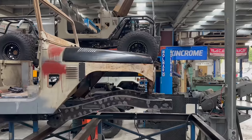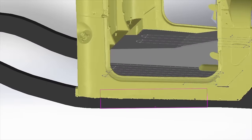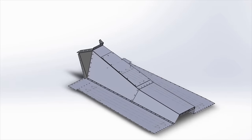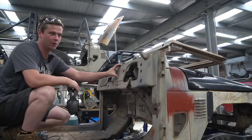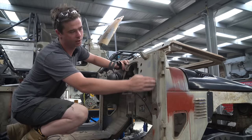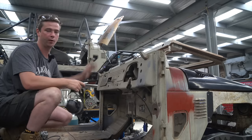The bonnet strut kit looks good and so does the cab on top of the chassis. Time to install the new dash, floor pans and transmission tunnel. We'll look at the design later on but first it's time to remove all the old parts. We're removing the dash - it's a double skin, so just cut through the welds, drill out the spot welds, get the chisel on it, crack them all open, give it a wiggle and a tap and the whole thing will just pop off.